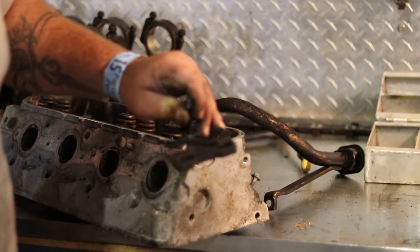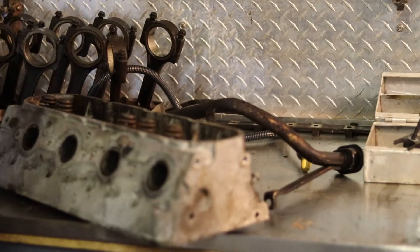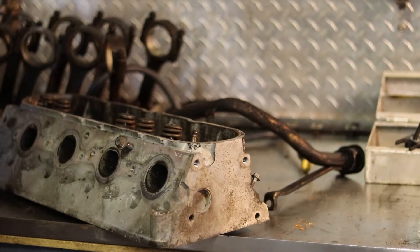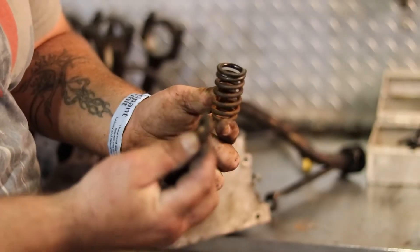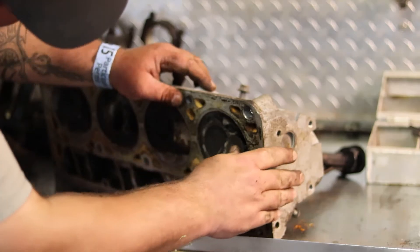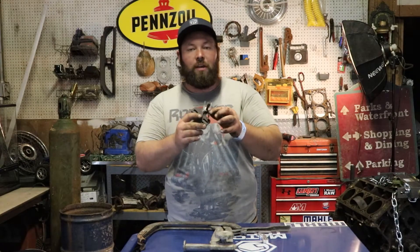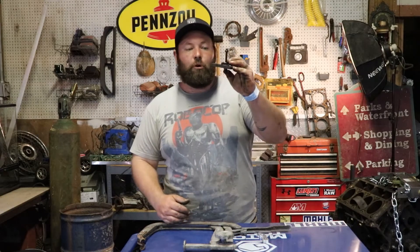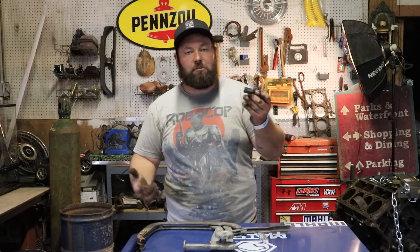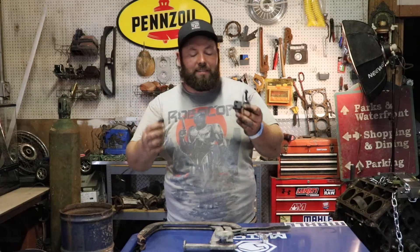This tool right here is really good for when the vehicle is still in the engine bay. This tool right here is much better for on the bench — a little cumbersome, but way faster to get things taken apart. I'm gonna leave these valves in it for now; the valve guides actually feel pretty good, but I am going to clean these heads up and lap them. The $13 Amazon tool — maybe pump some air into your cylinder, put this on, squeeze down the spring, take out your retainers and pop out the valve springs to change them. It also works on the bench, but you just have to go to the back side and hold the valve up for a quick second to take out the retainers.